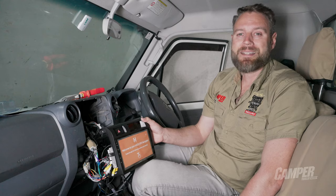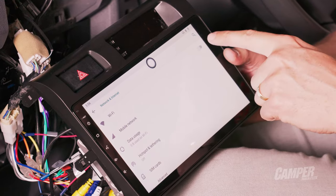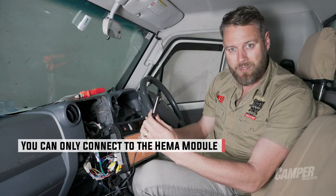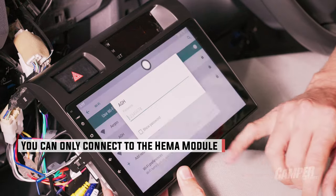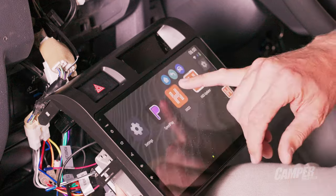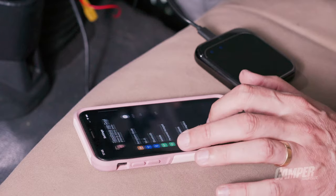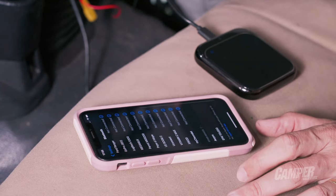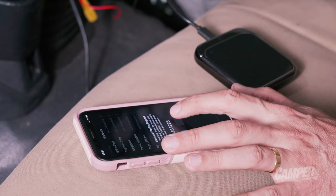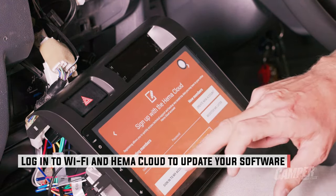And that's the hard part. Now it's about syncing your phone to the HEMA cloud account to get the best out of it. A little word of warning: because the HEMA module runs between the head unit and your phone, you need to connect to the module and not the head unit. Make sure you disconnect from the head unit and only connect to the AMH XD3 module. With the unit powered up, open up your phone settings, head to the Bluetooth section and look for the AMH XD3. Connect to it like you would any other Bluetooth device. Once you've got your module connected to the internet, you also want to log in to HEMA cloud on the device.